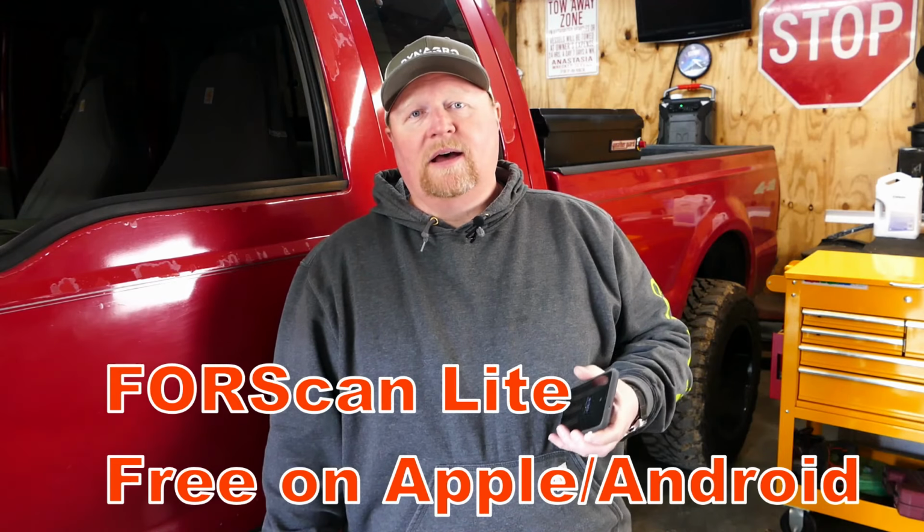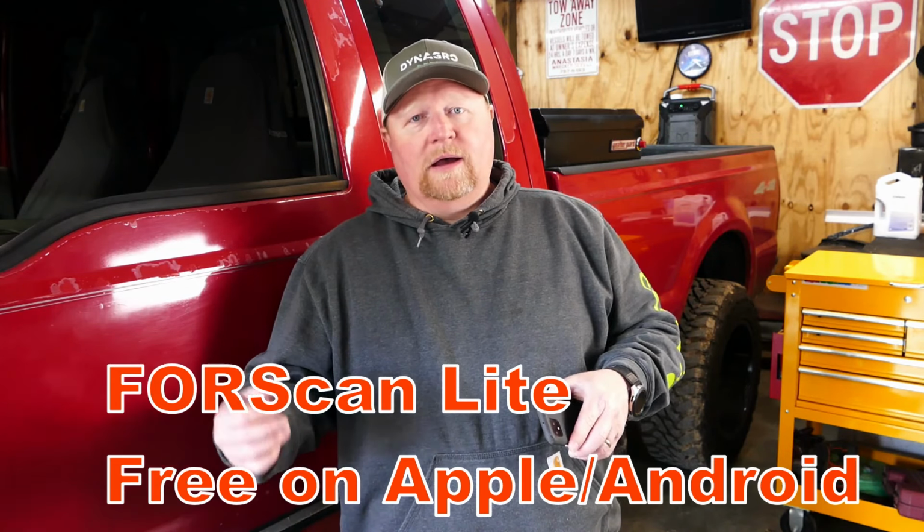There's an application called Forscan, and it works really good for pretty much all the Ford vehicles. You can make a lot of parameter changes and do a lot with it, but it's particularly helpful with Powerstroke trucks, particularly older Powerstroke trucks. I don't know about the newer stuff. My newest diesel stops at 6.0 and it does a good job there. Anyway, let's get into the Forscan app and see if we can figure out what the culprit is.